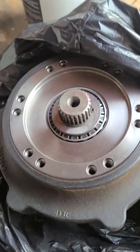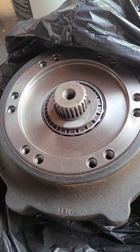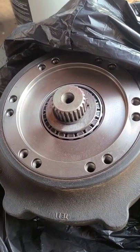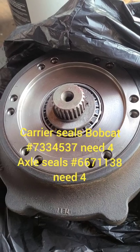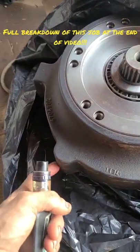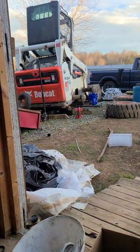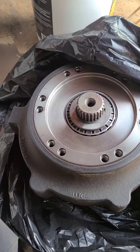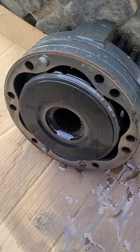I've also found out that if you've never done this before, this carrier from the factory comes with only one seal in it. This failure isn't very common, but when you do go to change it, you need to order two of the seals. Being my first video, I'm going to try to post the part numbers I used in the comments. I don't have the Loctite for the big bolts yet, but I've got one side put back together. I'll get the other carrier seal out, do the same thing with the press, and back together she'll go with new seals.